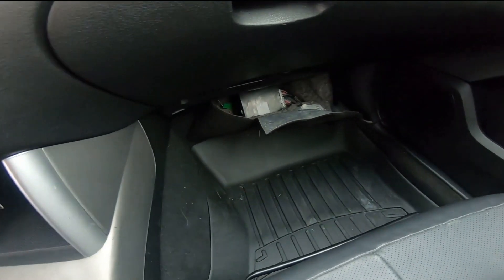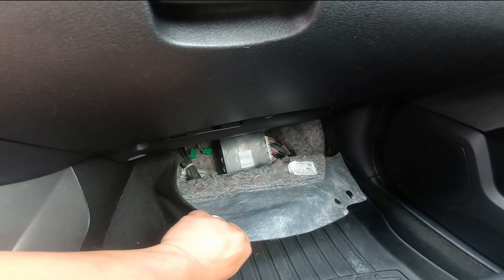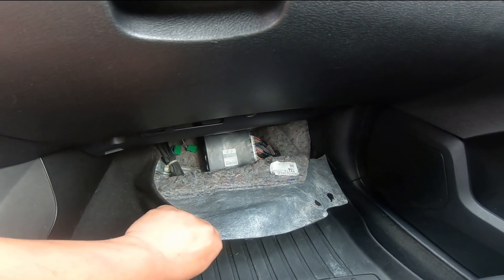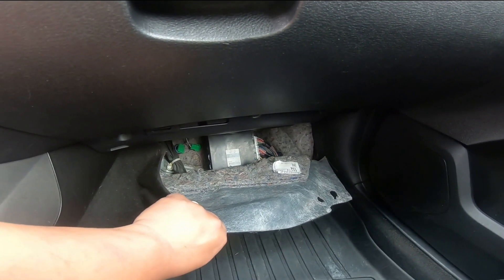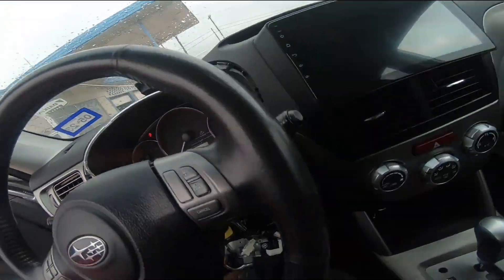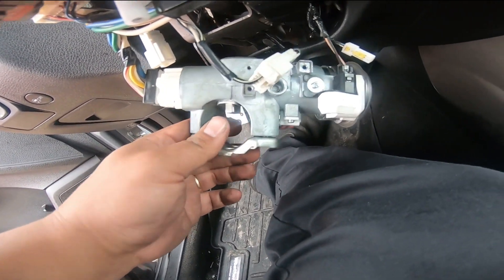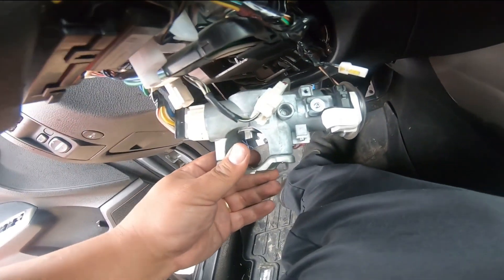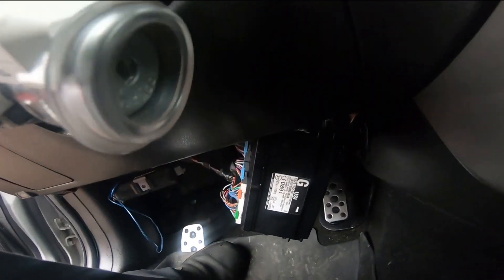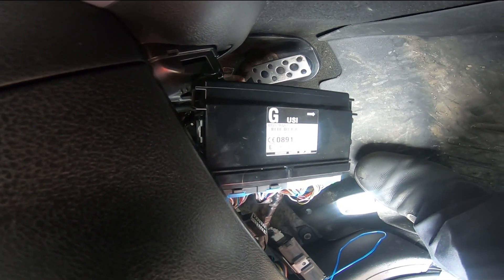So I had to go through a lot of things trying to get this right, and I wanted to make a video to help whoever is the next person doing this swap. Everything has to match — everything I got came out of an 08 STI. So that's the STI ECU, the STI cluster, the STI ignition key, and the last piece of the puzzle is the body control module.